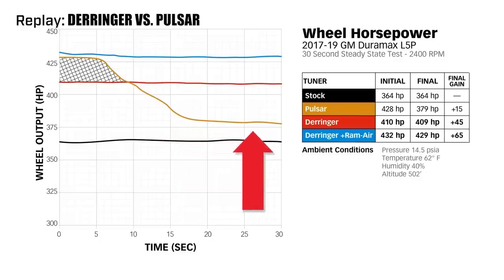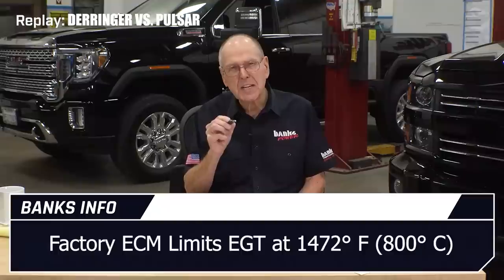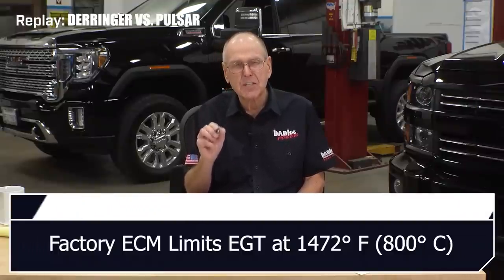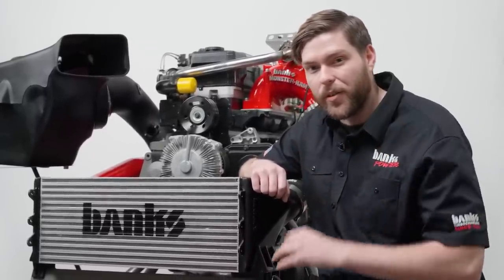What's going on here? The factory ECM has an EGT limiter at 1,472 degrees Fahrenheit or 800 degrees centigrade. That's to protect the engine and the turbocharger from failure due to excessive EGT. Parts that cause or are affected by any kind of temperature change need to be developed using steady-state testing, not short sweeps. With cooling components especially — just like this intercooler — the goal is to keep temps stable in extreme conditions, not just for short sweeps. When you drive your vehicle, you want to know it can run for hours, not seconds. Steady-state testing can even be used to more accurately measure the power curve.